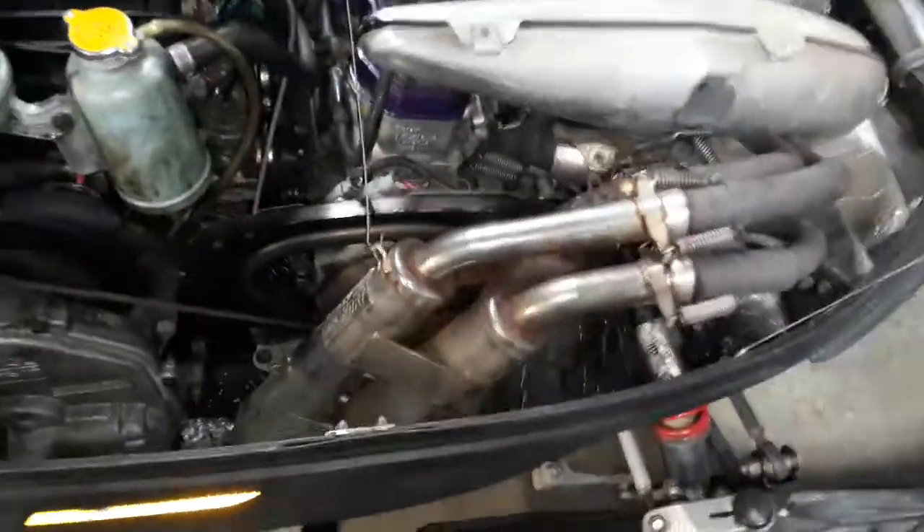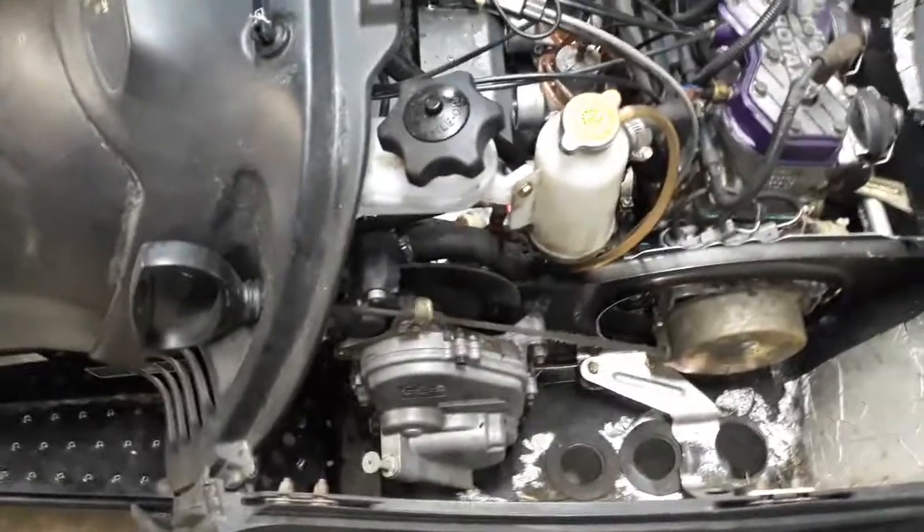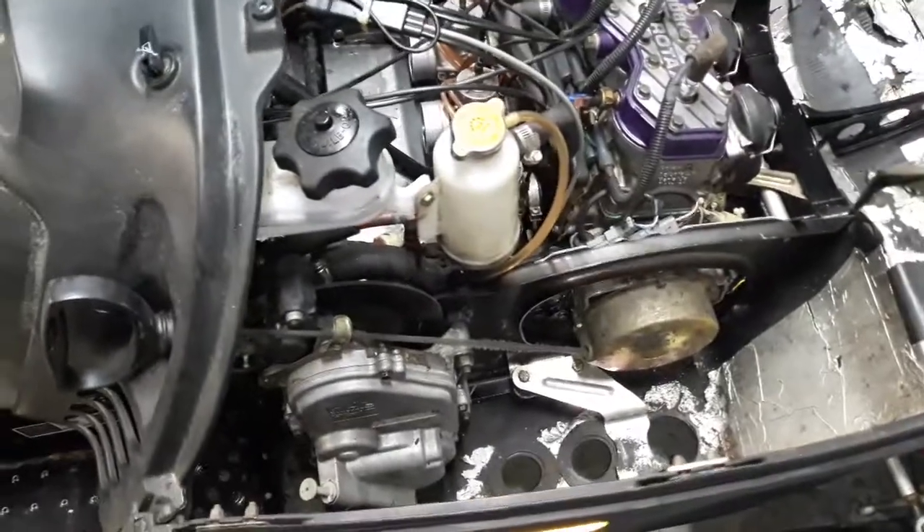I swapped the stator out and the stator was fine in this one. Now obviously I put my Dynoport pipe on this and took the stock one off, but that's the only thing I can think of. It could be the CDI — I really didn't want to believe it was because usually when CDIs go bad, they're bad. But on a snowmobile it might be a little bit different. I was also dealing with single cylinder two-strokes, so I don't know.